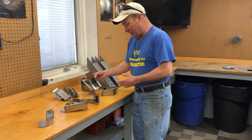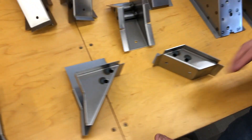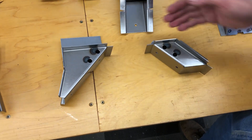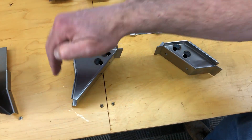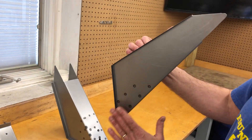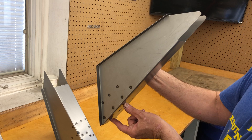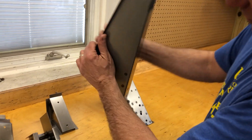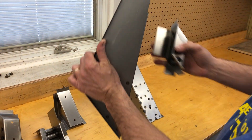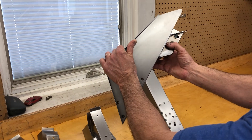If you come in and take a look — if you kind of look straight down on it, this would be the rear here. So this would be the right-hand side. This is the front and this is the rear. This piece here is something we've made for a few years now. This is the front section of the rear chassis leg. Right here is your rear sway bar mount. And then this piece goes right up in here — nope, that's the wrong side. I knew I would do that as soon as the video starts. This piece goes right up in here like that.